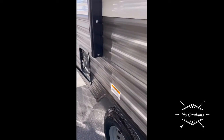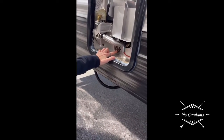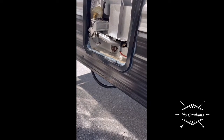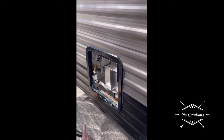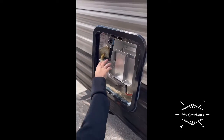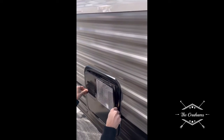This is your water heater down here. This is what we call a zinc rod — it takes any corrosion or damage for the water tank. I recommend you check that once a year. If it's rusted or corroded on the inside, replace it; it should be silver and clean inside. This is a brand new one, so you should be good for the next year. If the water heater ever doesn't start, there's a reset button right here — if you have no hot water, come out here and reset it.